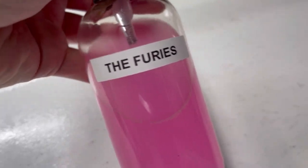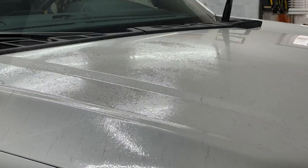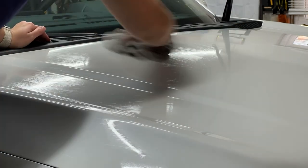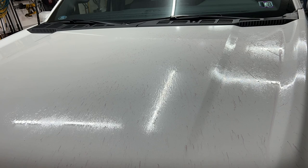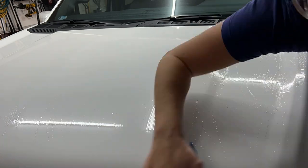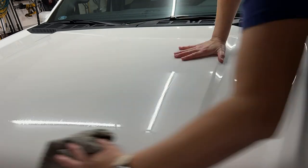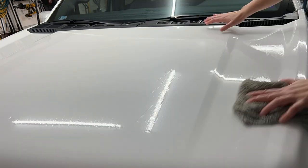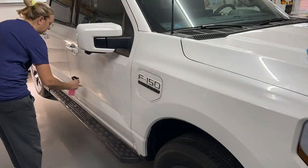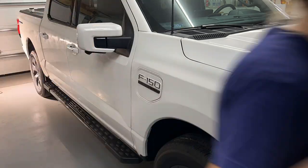Even though this is a brand new truck, we have a crazy amount of reaction going on this hood — what I'm seeing from this iron remover is very impressive. We let it sit for about a minute or two — you don't want to let it dry on the panel. We sprayed our rinseless solution, came in with our clay towel that had been soaking in the rinseless solution, then used about two microfiber towels to wipe up all of that residue. I didn't put those towels back in the bucket — a fresh side every time so you're not putting iron remover back into your solution. This method worked very efficiently: wash, chemical decon, manual decon, wipe off all residue, dry everything — in about 45 minutes total from start to finish.